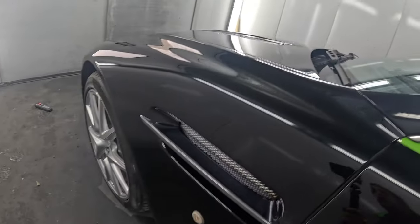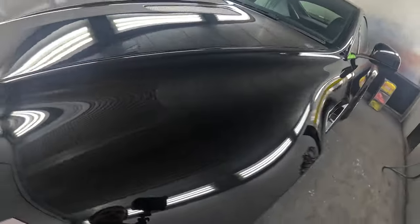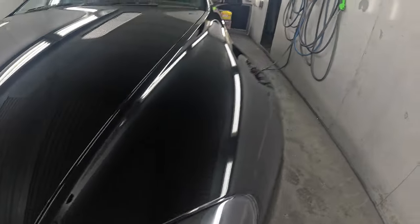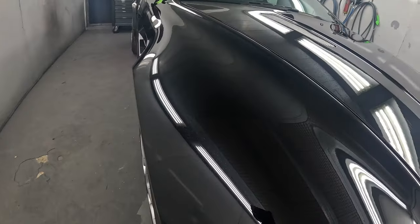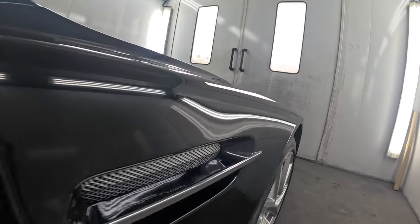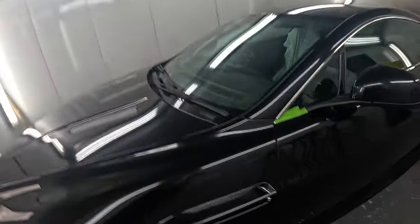All looks pretty flat, sort of how they should look, not complete glass. But it's definitely flatter than, you know, a gun finish. And not too difficult to achieve that finish, really. There's so many ways you could go about flatting and polishing. But these are not complete glass, these cars, but they are flat and polished. So yeah, I just went through the grades, started off with 1500, just on the DA, then 2000, then 3000, and then a heavy cut machine polish on the rotary polisher, and then a medium cut on the dual action polisher. And yeah, I think the results are all right.